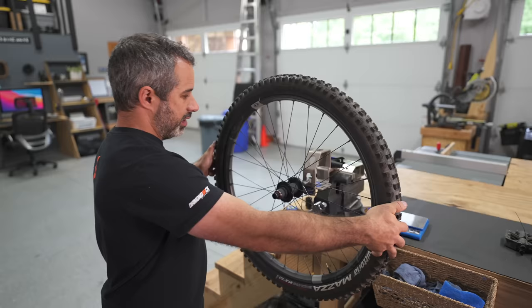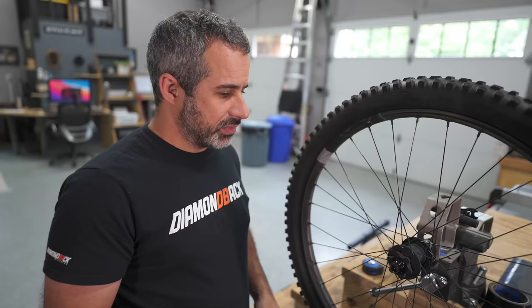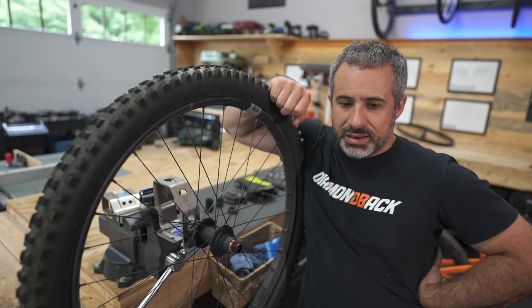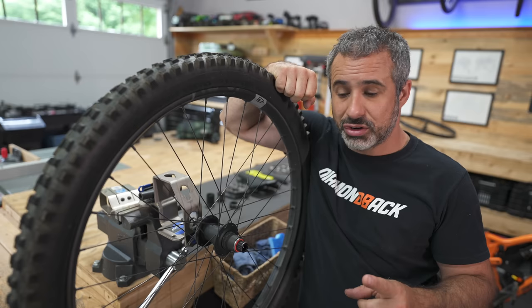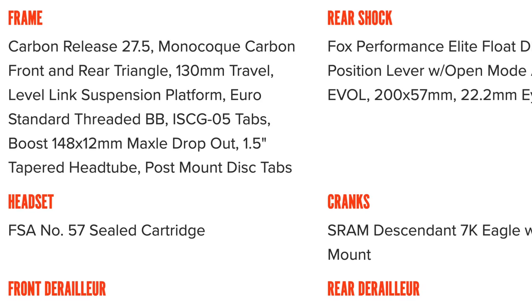Flipping the wheel around, you also need to know the rotor mount type: six-bolt or center lock. Six-bolt rotors bolt on with six small bolts; center lock has a spline and a lock ring. It's pretty easy to tell which you have. Now, the width of the wheel — the axle standard — is actually the most complicated part. There are about 85 different standards out there, which means it's not really a standard anymore. But most mountain bikes these days are Boost 148. Check your manufacturer's specifications if you have any questions.